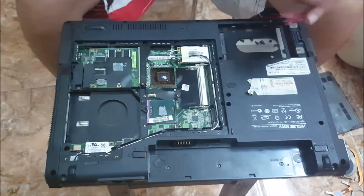And that's about it. Thanks for watching. Like I said previously, this laptop suffered from heat issues, and this is why we had to open it up. After cleaning out and replacing the thermal paste, the laptop was like normal again and worked as it should. So if you have heat issues, this generally resolves your issue. Thank you, and thanks for watching.